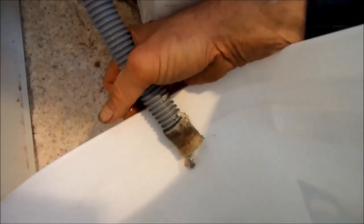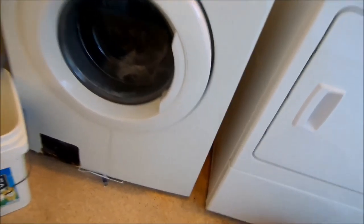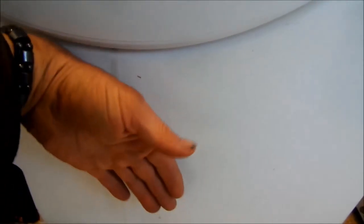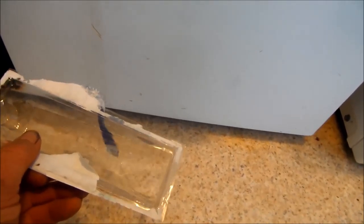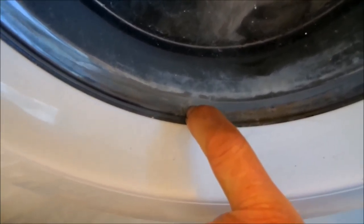We can drain some of this water. We still have a leak problem too. We can see the drip here at the door — you can feel it, it's wet. Right here we see water in there. It has a bad boot. You can see right here, if you look closely, there's a cut — there's a rip in that boot right there.